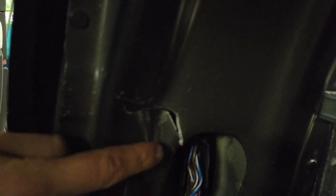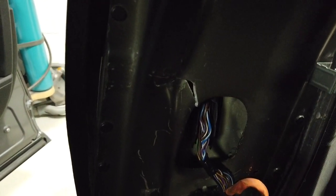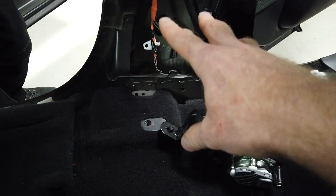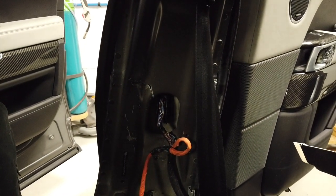The other thing that's quite horrific - you can see there's a horrible little crease in here. The camera's caught it there. That's where they've jacked it out - there's a seat mount in the floor here and I think they've put a ram across to straighten it. It's looking pretty grisly but not too bad. Having said that, the floor's all square and the seat belt mount all looks fine. I think it just took something fairly high up the door.